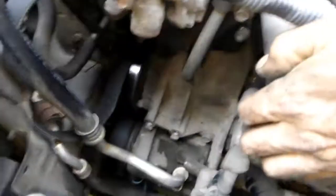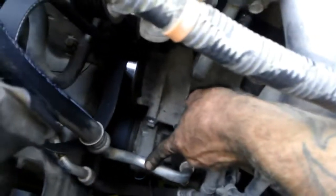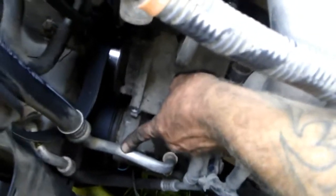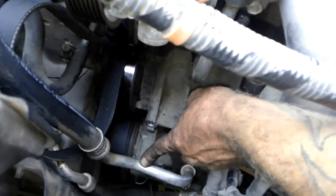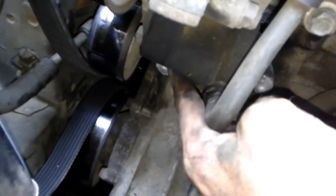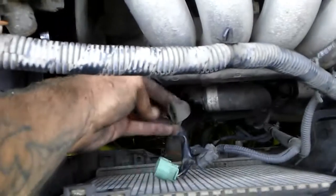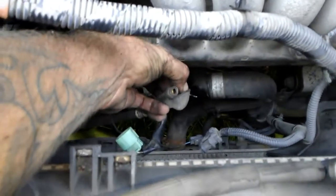You've got two bolts low, here and here. This one was a little tricky with my deep well socket because it was touching the AC line, but I was able to get it on. I wasn't able to remove the bolt all the way, but after removing this bolt and the other top bolt up here on the alternator, I was able to wiggle it and it basically fell right out. Don't forget to undo your plug — I did that with the alternator still bolted on the car.